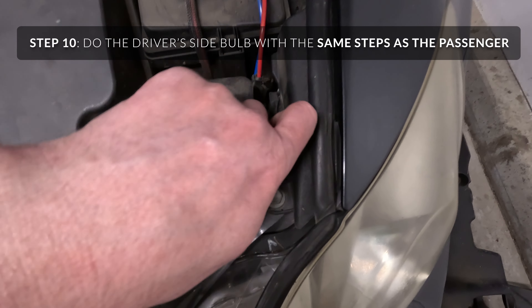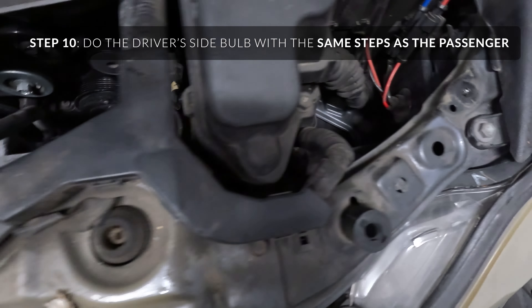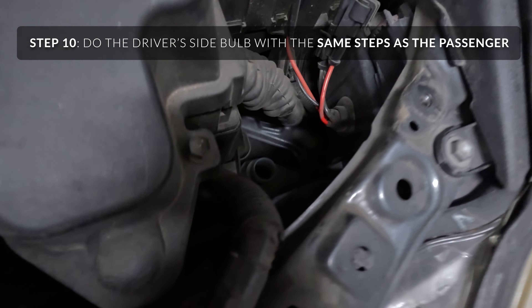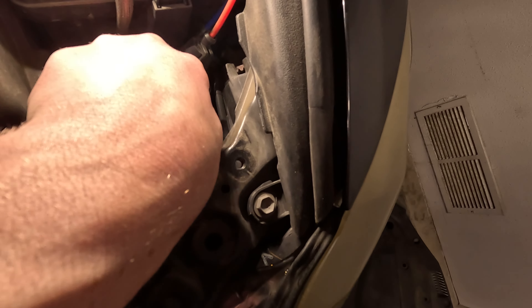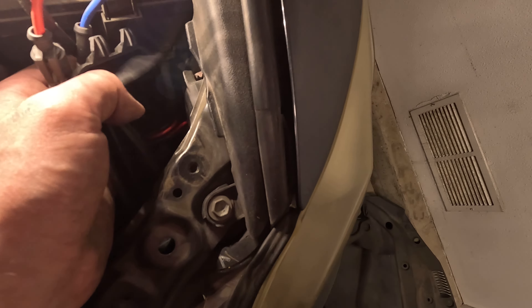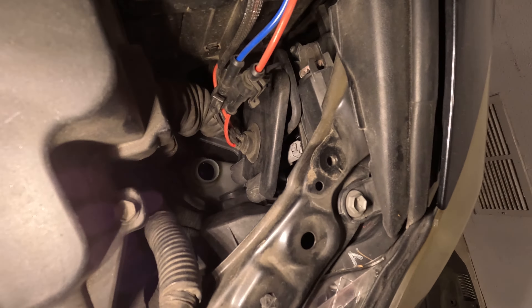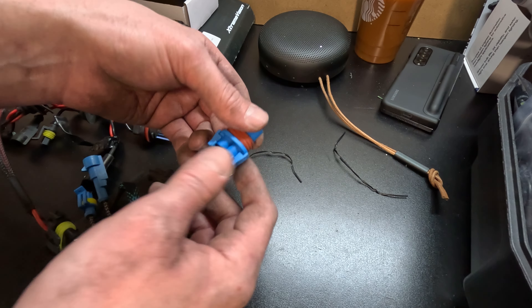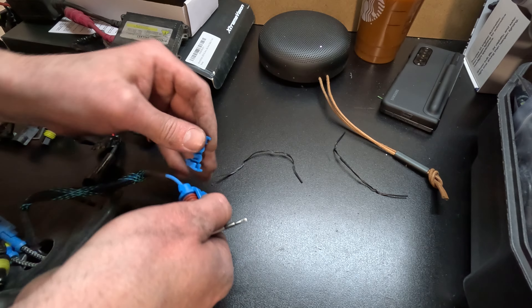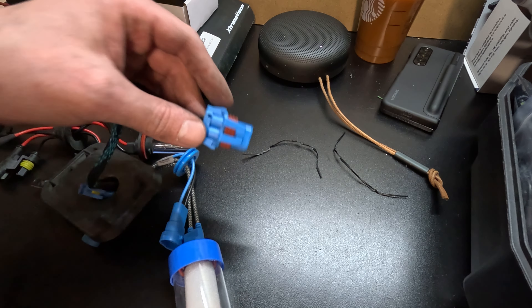On the driver's side, remove this 10mm bolt and just pull this up and off — it slides over the top. Really simple. This is a very simple car to work on. Once you're in there, you have a clip — pull that towards you and it will slide off, just pull it outwards. Remember those two hooks are on the side. You can also remove this back clip to snap these out, which might make it a lot easier. When you get it through, snap it back on.